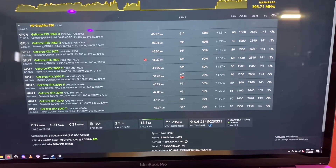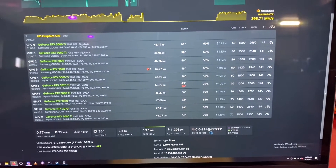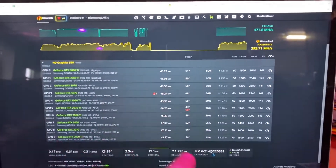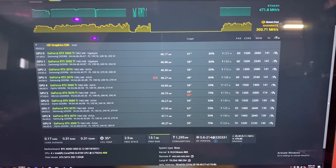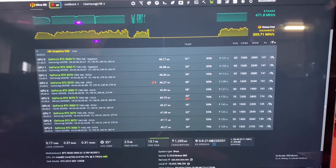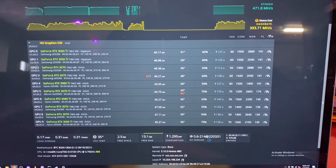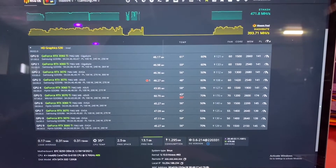Here's the other rig that only has 10 cards on it right now. You can see it's only using like two gigabytes of RAM for 10 pretty high-end cards. I had a dropout yesterday because one of these cards had a memory fault, but the board itself has not had any issues. I've been adding cards and they've been detected right off the bat, started mining with no issue. I've not run into PCI Express resource issues like I have on the version with the full slots. If you're buying this with no intent of using it past mining, I'd highly recommend this version over the version with real slots — it just seems a little bit more stable.